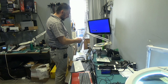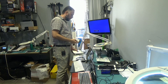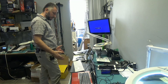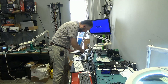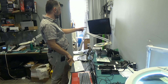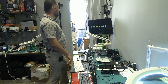We have the HDMI cable plugged in, the keyboard plugged in, and an external drive plugged in. We're going to press the Option key while the computer turns on so we can see the partitions on this drive — we should have about 10 partitions. If we see them, the password is gone; if we're greeted with a password prompt, the EFI password is still there. Let's turn it on — press and hold the Option key — and right there, the password is gone!